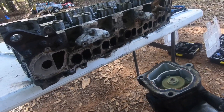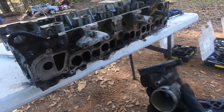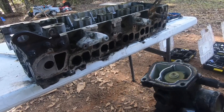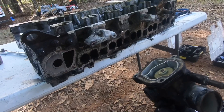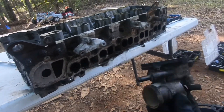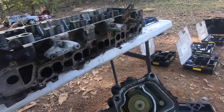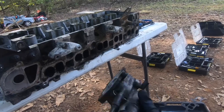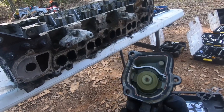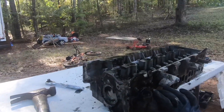And if you've got a summer thermostat in the wintertime, you're going to have issues as well — the water is going to be circulating in the engine too much and you're not going to be able to build any heat inside the cabin, resulting in a really cold Sprinter. Good luck being in negative 50 degree weather — you're going to be freezing your feet in your Sprinter. Hopefully this has helped, because I received many requests to make a video on the thermostat. This is where it's located, in front of the engine.